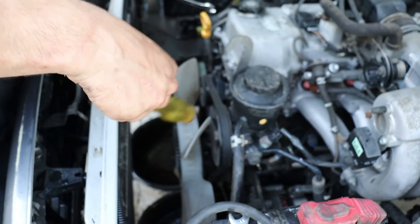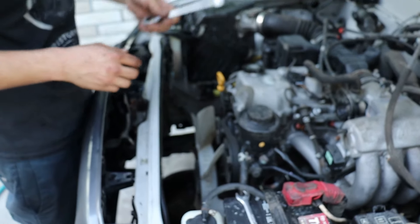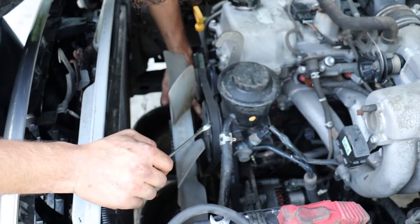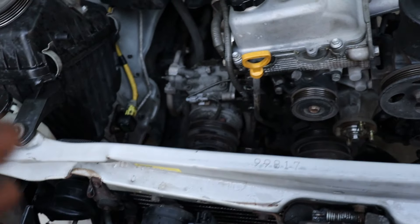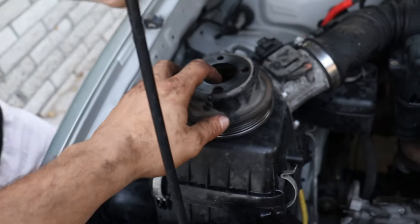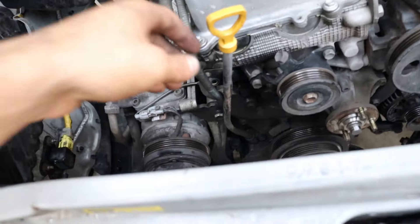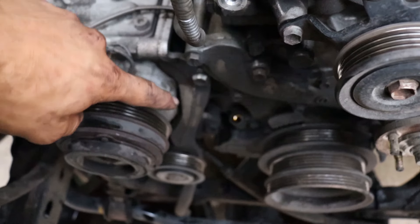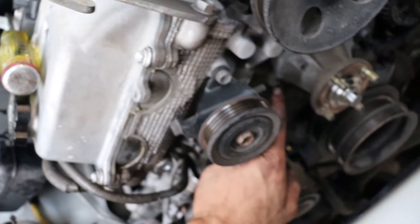Now all 4 of them are loose. Those things are always a bitch. So we got that fan stuff off — it comes off super easy — and then the pulley behind it just pulls off when you pull those 4 bolts off. And then one bolt right here, 12mm, that holds this guy on. So literally this thing is all 10s and 12s. We're going to pull this out and set it aside, then get down on these water pump bolts — a combination of 12s here and some smaller 10s going around it.